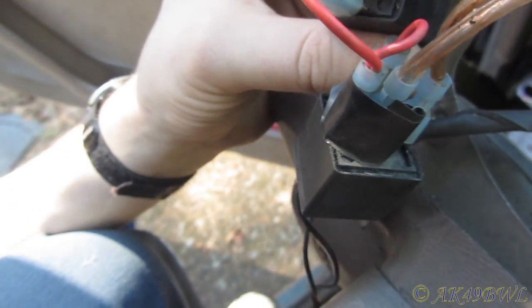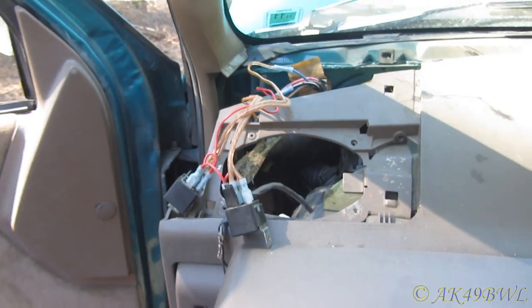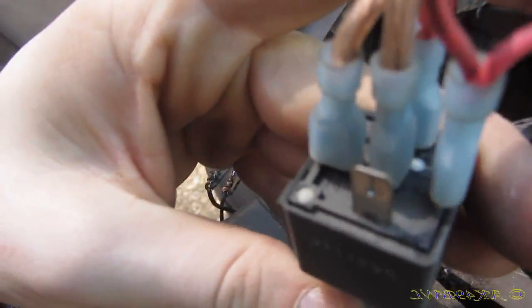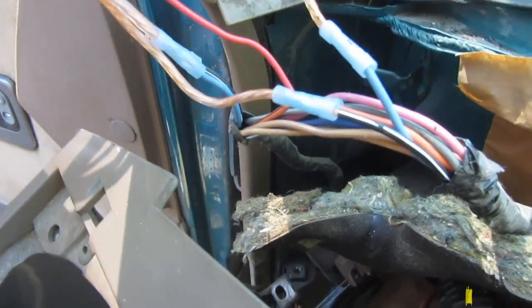These relays can't even activate. They serve absolutely no purpose whatsoever. So then the real question is, why are they here? This makes no sense. It's impossible to activate them because they have no ground lead, and it appears there was never even one tapped.